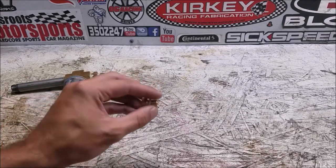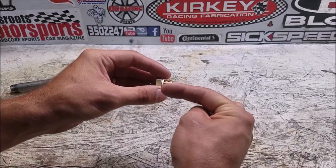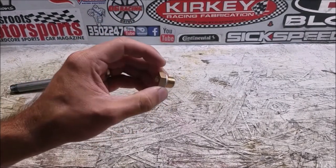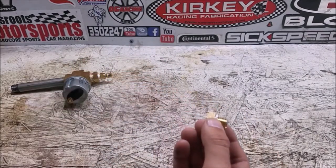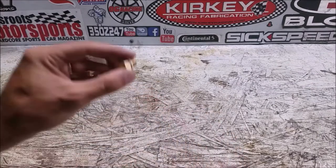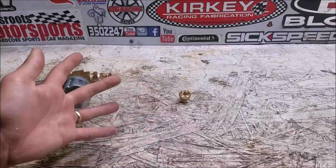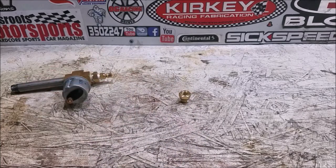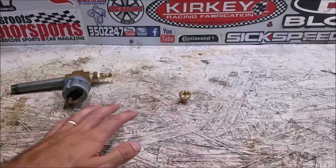All I have to do is unhook one wire and thread this out. Luckily, the Mini has the drain plug on the side of the oil pan, so it's tucked up out of the way and safe. It's also conveniently facing backwards, so the wire runs under the engine and gets zip-tied out of the way. The only downside is losing the magnetic drain plug I installed, but I would rather have oil temperature. With the Mini's exposed oil filter, I can check for metal flakes each time I drain the oil, so it shouldn't be too much of a loss.